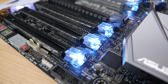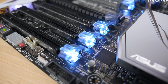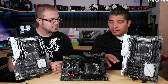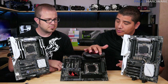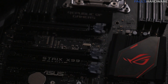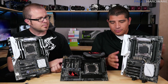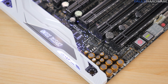One implementation for LEDs we haven't seen before is that they're actually sitting right beneath the little clasp on the PCIe slot. The clasp is semi-translucent, very similar to the housing on high-end mechanical keyboards that allows for superior diffusion and lighting. All these boards - whether the Strix, Deluxe, or Dash A - feature these multiple zones of lighting. The Strix takes it a little further with RGB lighting built into the I/O shroud, and the Republic of Gamers logo in the center of the board is full RGB.